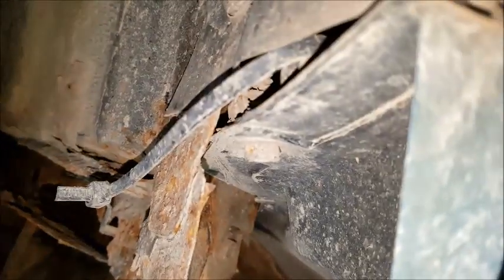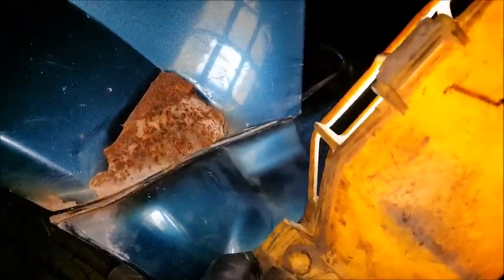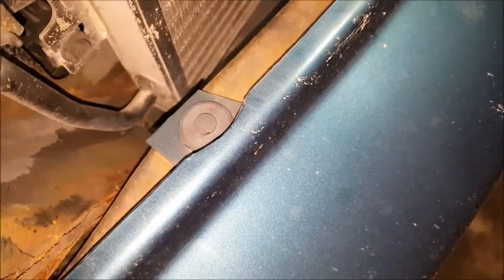It is typically my luck — that bolt had twisted off, so I've got another problem. There is a bolt right there that holds this fascia on, but on mine it seems to be rusted loose, so I'm not going to bother taking that out. This whole thing is kind of loose there. Seems like there's something holding it, but I'm going to try to take out some of these push pins and try to pull this fascia away from the body enough to expose the fender bolts.